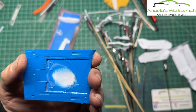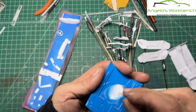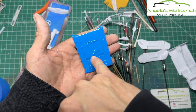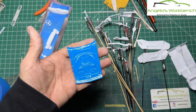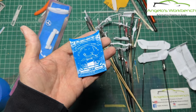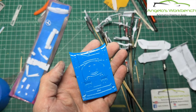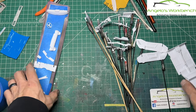The plastic piece around this will be blue, this will be black, but this entire reverse side of the hood needs to be blue. So I'm going to mix up a little Grabber Blue and spray this hood, because while I'm spraying the other parts black I want to spray this hood too. Fresh out of the spray booth — one blue reverse side of the hood. You can see easier now the section that has to be black: just this little half circle where a black plastic piece attaches to the air cleaner. You can see the impression of the air cleaner.